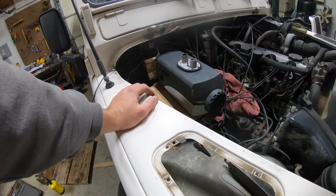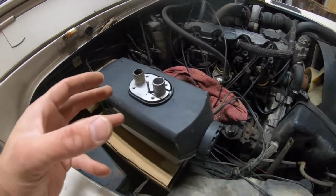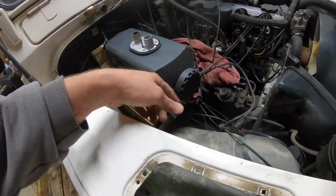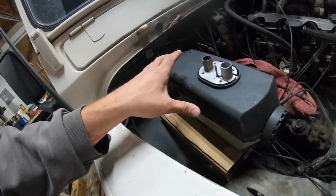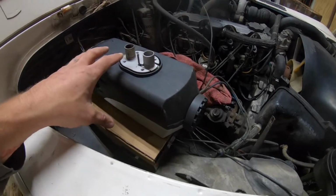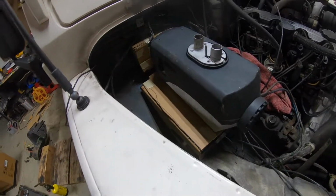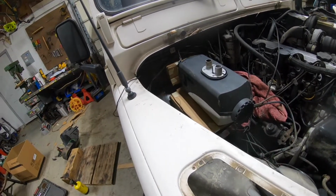it might give me a little more insulation to keep the heat in the heater. Because right now, there's a thing in here, the combustion chamber, and literally that just gets hot and the air comes in, and the only thing really insulating the combustion chamber is the plastic around it, which isn't insulated at all. It's just plastic. So if I made a better box, or a bigger box around it full of insulation, I could keep the heat in better, which should result in a hotter cab.